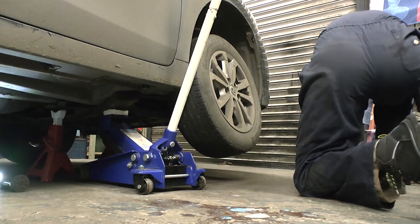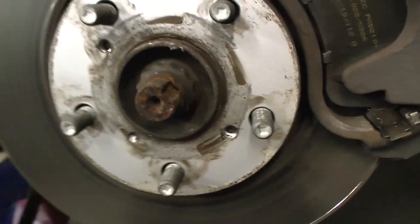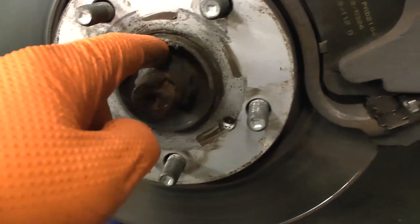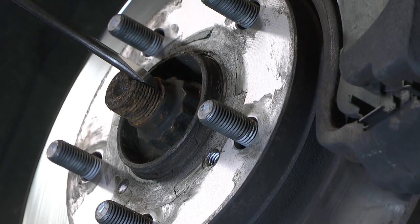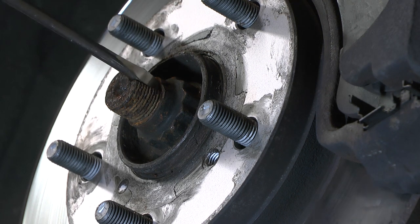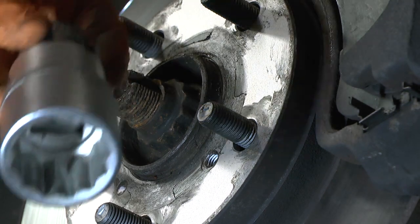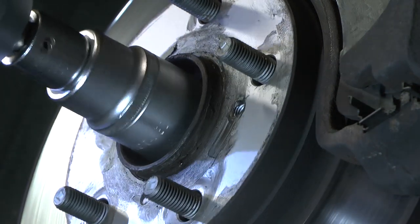Loosen off the wheels while still on the ground — that has to come off. I'm going to lift the car a little, dig out the screwdriver, lift it up, and then this has to come off. I'm going to have to take the hub off — it's been bashed down here to get this wheel on. Lift this little tab up: 30mm, quite deep, on a half-inch adapter.